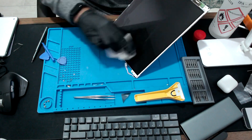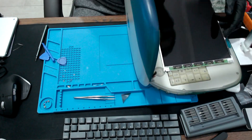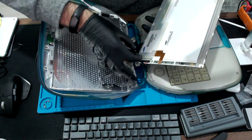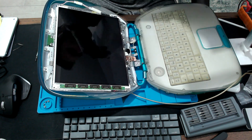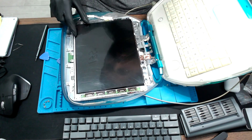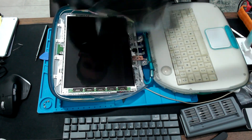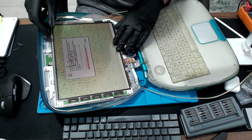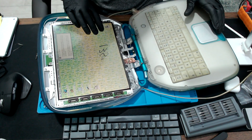As you can see, now all the glue has been removed and the glass looks very clean. I finish up using some window cleaner. Now I connect the display back to the motherboard so I can turn it on and try the new polarizer film — I need to make sure of the orientation that it has to be glued. As you can see, depending on the orientation I put the film, the display looks different. The polarizer film needed for this laptop has to be 135 degrees. I'll put a link in the description to the one I bought from Aliexpress.